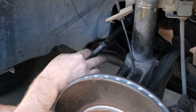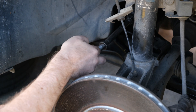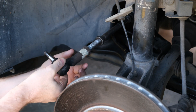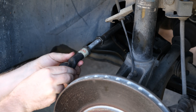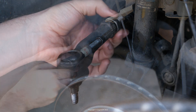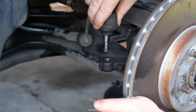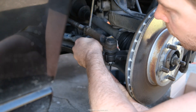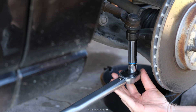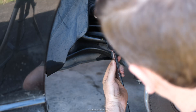We're back to the in-car perspective — rack working okay and the boot flexing as it should. When putting the outer rod back on, count the same number of turns it took to get it off. I like to use some anti-seize on the threads to ward off corrosion — these are the bits that get turned and adjusted during an alignment, so it'll make life easier for the alignment guys too. The nut on the outer tie rod spindle is another job for the torque wrench: 40 Nm on this one per Ford.